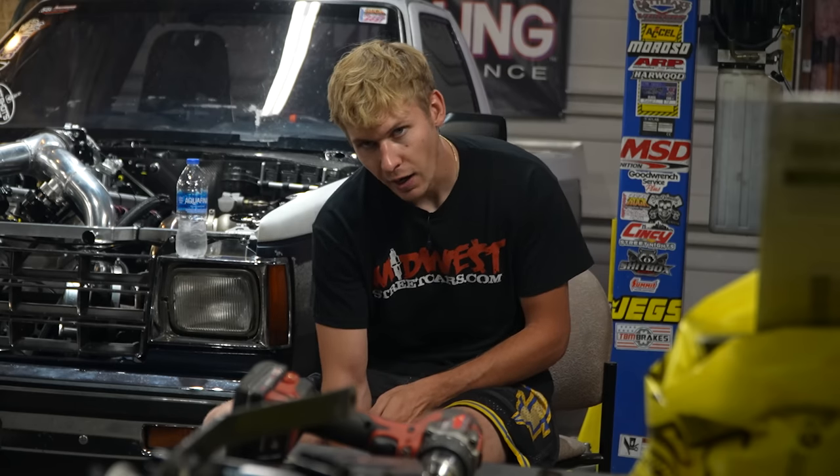It's going to be really fast. The 388 is capable of 2,000 horsepower. It's going to get bigger turbos. We're going to use the same injectors for now because they've still got some room left. They're only at about 60% duty cycle right now at 35 pounds of boost. So I think we can stretch them out a little longer and maybe upgrade those in the future. But for now, we're going to stick with our 16 injector setup.